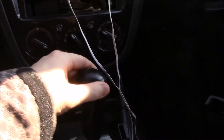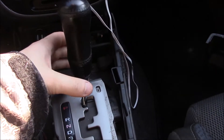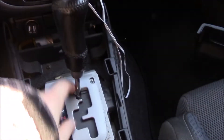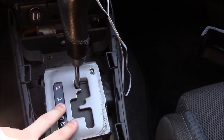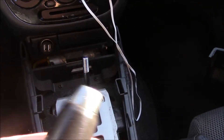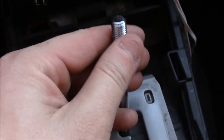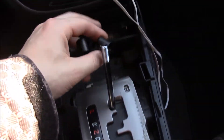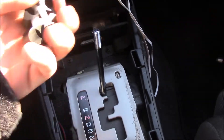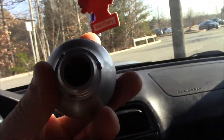See how we got that — this piece just lifts and pops right out. With automatics, just give it a good twist and spin it off. This stock knob is nice, it's got nice leather stitching, but it's big, bulky, and awkward to grab. I don't use the shifter a lot obviously — there's a gauge up here to tell me what gear I'm in. We're just going to go ahead and switch it out and cover it up. As you can see, there's already an adapter in there — basically for the threaded rod. Most manual transmissions just have a rod with no thread, that's why they give you these adapters. We're going to go with the smallest one.